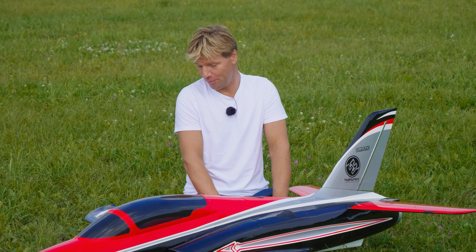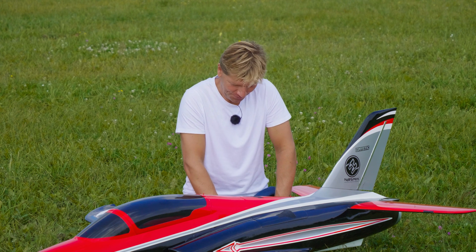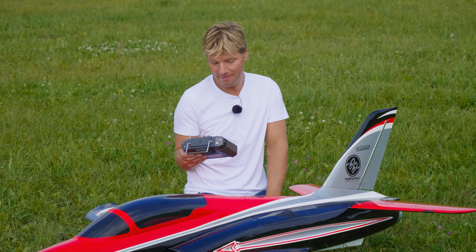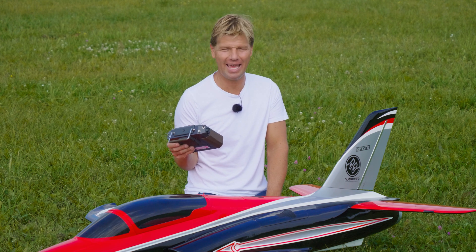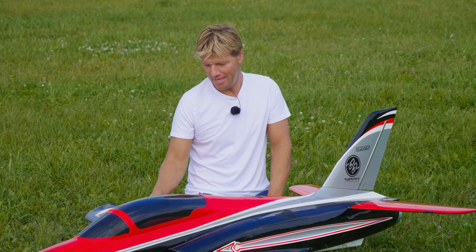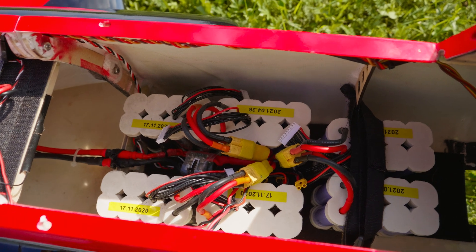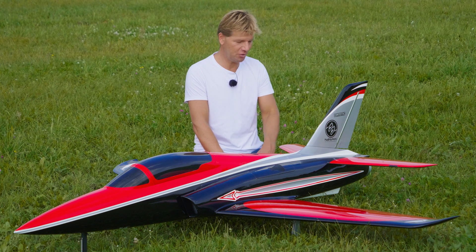The flight time was amazing — on the 130 we flew six and a half minutes almost, super nice. A very important thing: the temperature of the motor during the flight was only 52 degrees, which is nothing, which means I can push it even harder. At takeoff we had 10.8 kilowatts, 206 amps, then it dropped to 9 kilowatts, and in the end almost 8 kilowatts. The low temperature of the motor means I can put another set of 16S batteries and go up to probably 12 kilowatts because the motor and ESC allow for it. This is a very efficient set — this is a good drive for sure, a drive to stay.